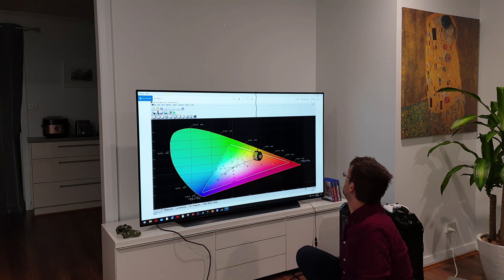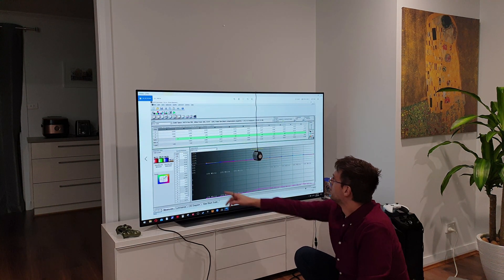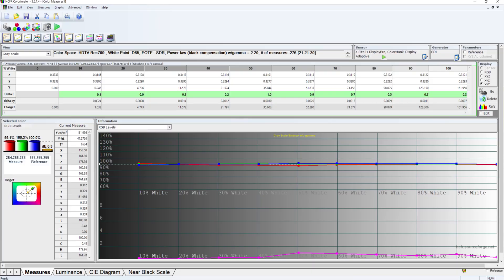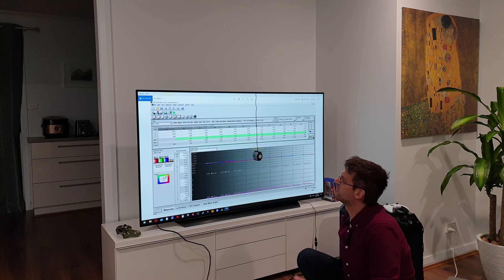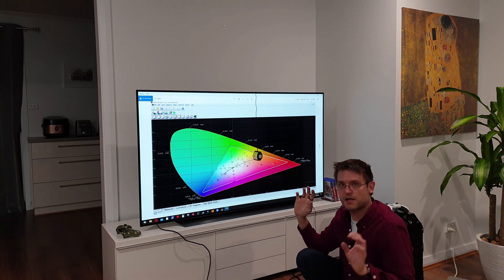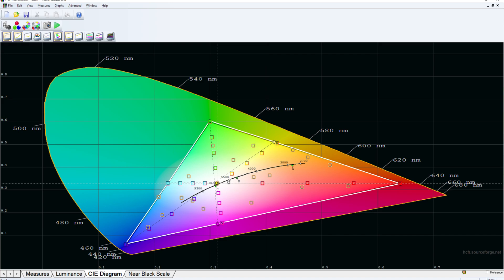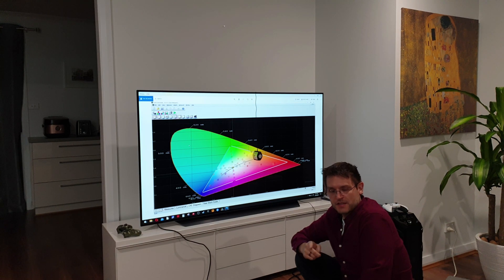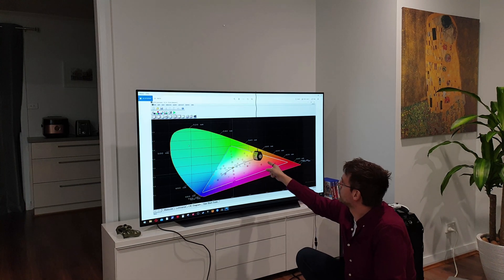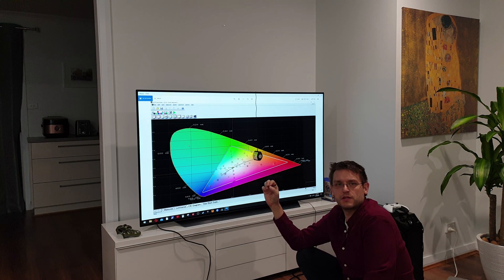So far I'm happy with this. I also did a quick calibration in Expert Bright Room mode — the highest delta E point is 1.0 at 50%, so there's a slight discrepancy at 50% but that's really just a minor thing. And again, the color space without touching anything in the color management so far is a very good result.